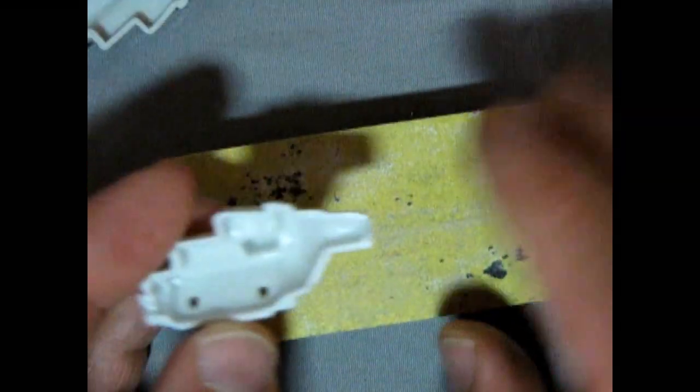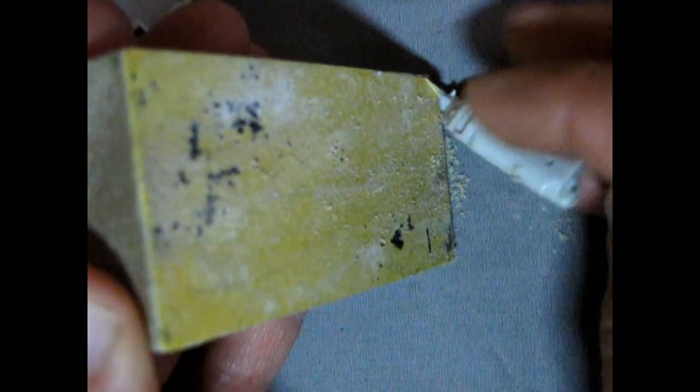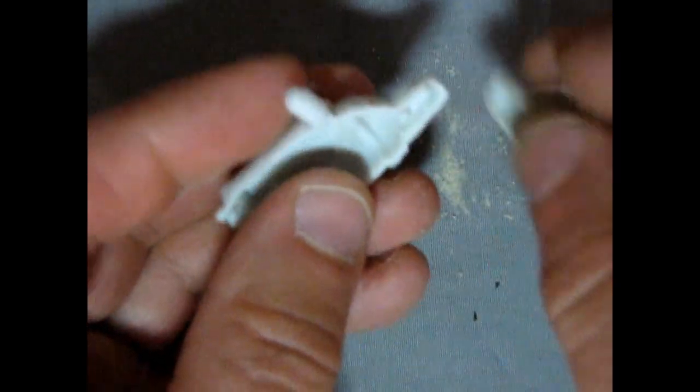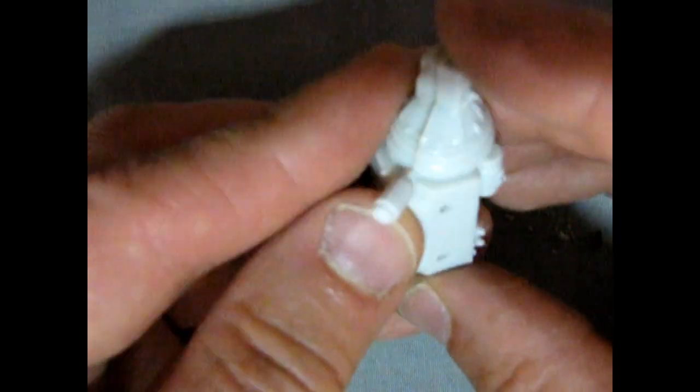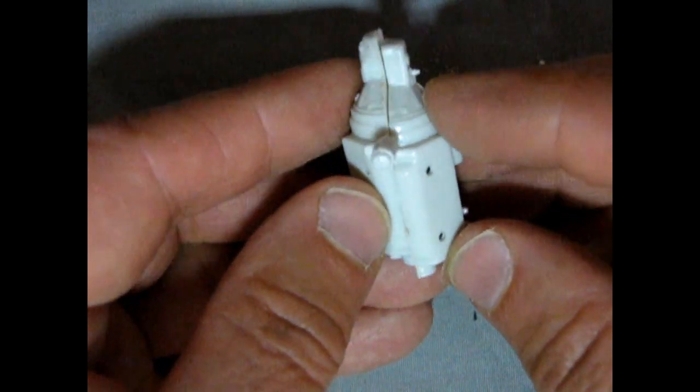So what we'll do is we'll take our block of sandpaper here. Just going to carefully flip this over. You want to tilt it up where you can see what's going on. And I'm just going to carefully rub the engine block against the sandpaper here, just to help smooth it out. This is basic stuff, actually. So I'm going to keep it up here, away from the magneto. Just move this side carefully. We're not trying to obliterate it here, but we are trying to get this as a nice flat surface. Now, without the locator pins, you've got a lot of room to move this engine block back and forth, or up and down, however you see fit.